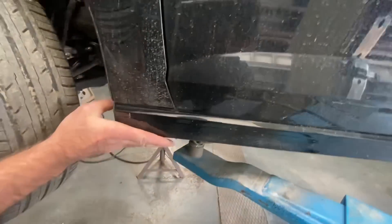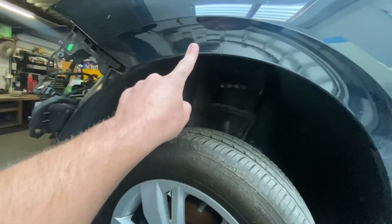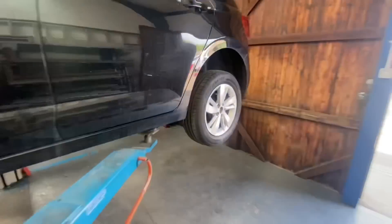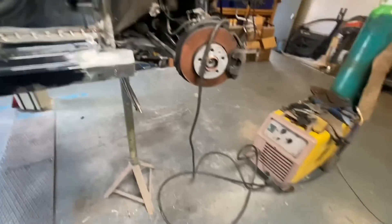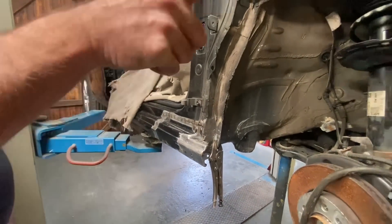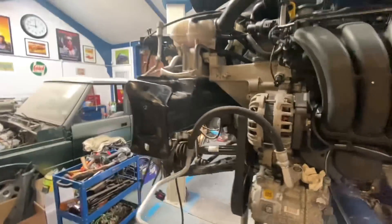The other side has a slight concave all the way until about here somewhere, and you can actually see it dips in, and then it actually goes very slightly the other way. Chris is saying it's like what he saw on the Passat — the first quarter panel he ever did. That was quite tricky. Unbelievable how quickly this one is coming along now that the main structural repair is done. I would say that was the hardest part of the repair on this car — well it is really the only big bit. That little mark on the front cap is tiny. So many people have asked about the slide hammer — we quite often show it on time lapse, but we've only shown it in real time once.